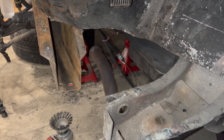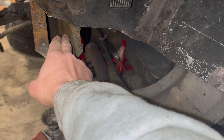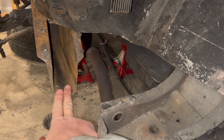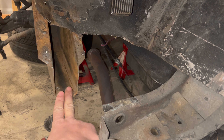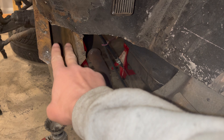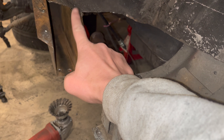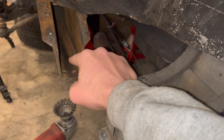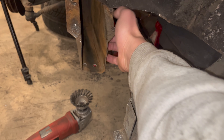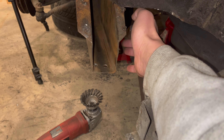On the inside, I got as far up in here as I could with a wire brush and cleared out as much as I could, but I have some Eastwood Rust Encapsulator. Once I get everything out that I can mechanically, I'll spray as far up as I can go. That's all surface rust — I imagine from just being left in the elements, these parts weren't primed — but similarly that is all solid metal. So very happy, no concerns there.